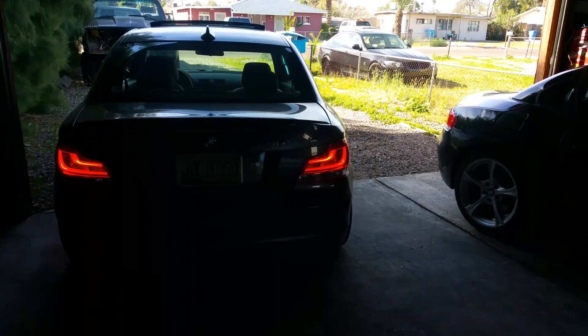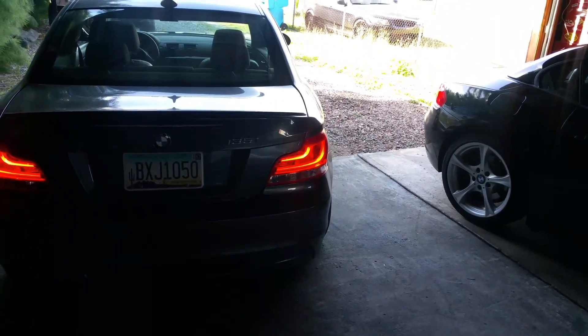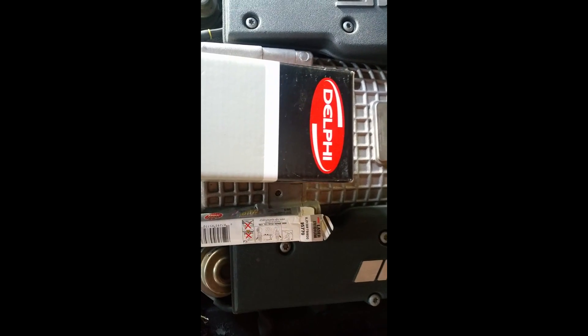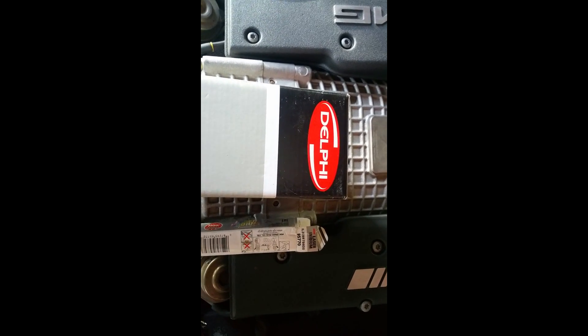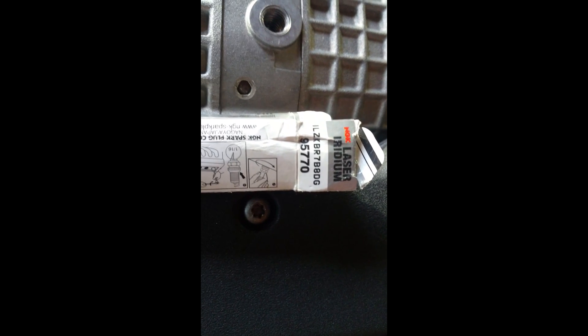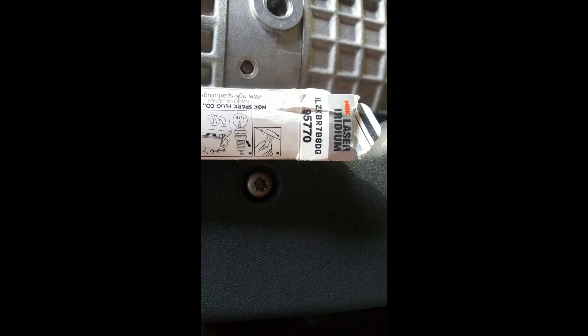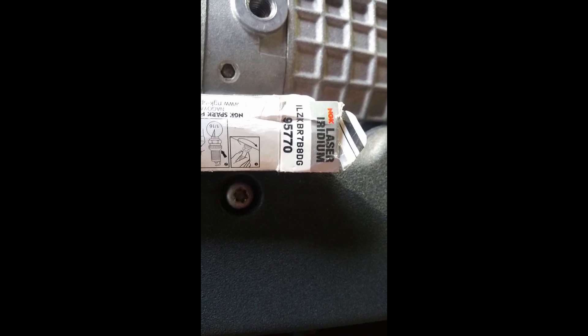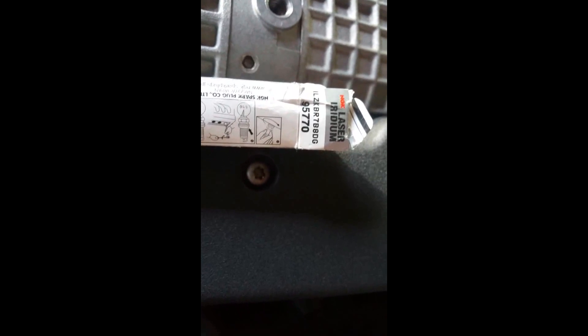What we're going to do today is the basics — a basic for idiots. When you turn up your boost, what you're going to have problems with immediately are your coils. So it's recommended you replace your coils with good new coils. I recommend Delphi, or you could go with a newer brand. You also need cooler plugs and new coils because you'll find out right away once you turn it up.